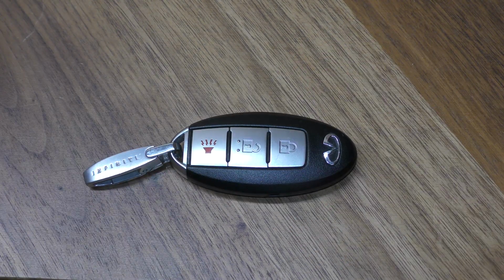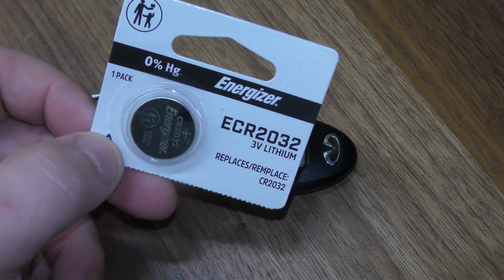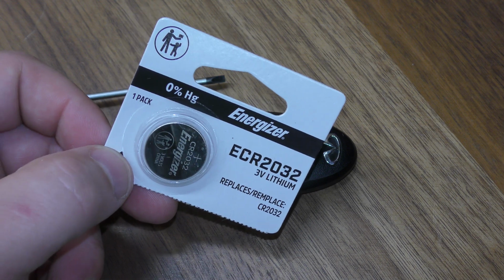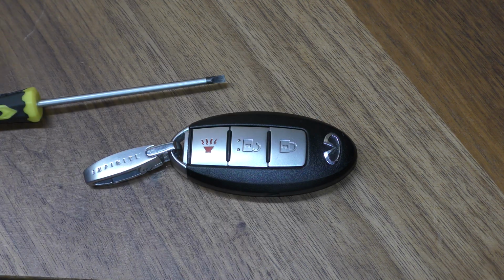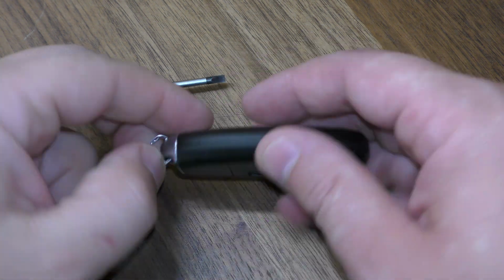You're going to need a flat tip screwdriver, smaller the better, and then one of the replacement batteries. This takes either a 2032 or a 2025, and you can get both of these off Amazon. Check the link below in the description, that will take you straight there.